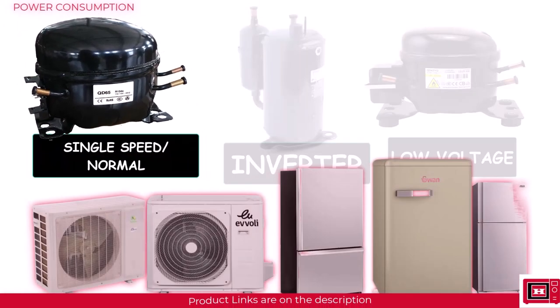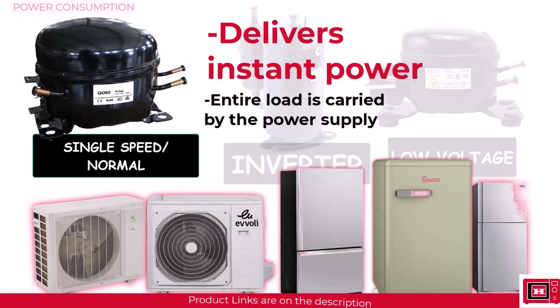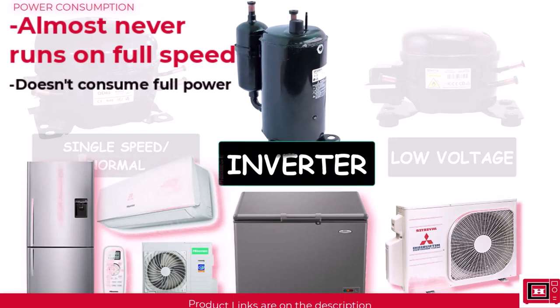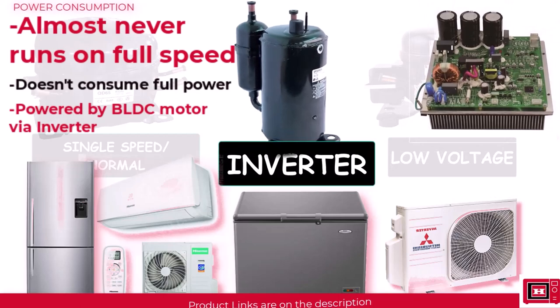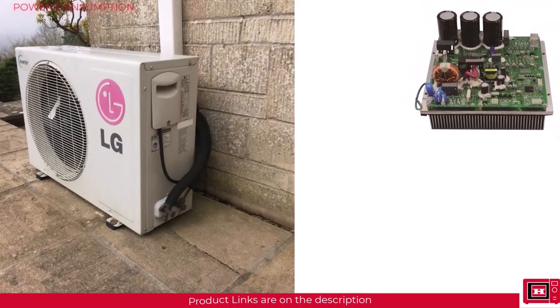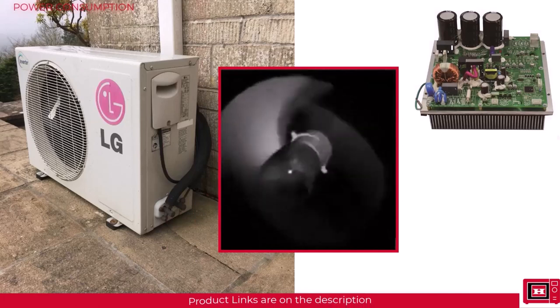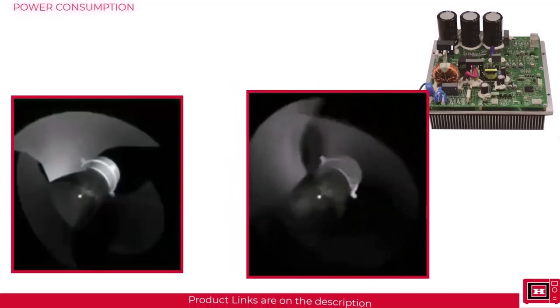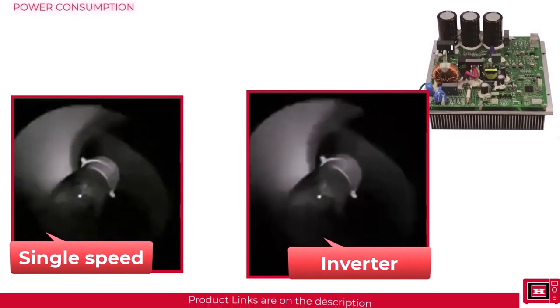When it comes to power consumption, appliances with single speed or normal compressors deliver full power to the compressor instantly while running, meaning the entire load must be carried by the power supply. The starting power required to get the compressor running each time it goes off and on must also be supplied. Inverter compressors, on the other hand, almost never run at full speed or consume full rated power, thanks to the motor controller that adjusts speed according to desired temperature, saving a lot on electricity bills. In inverter split unit ACs, the inverter circuit board also controls the outdoor fan speed within 400 to 950 RPM alongside the compressor, regulated according to temperature to save energy, unlike the single speed type that uses a fixed 800 RPM outdoor fan that goes off with the compressor, adding to the starting power requirement.